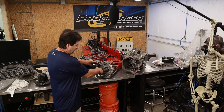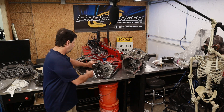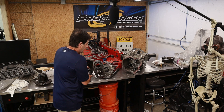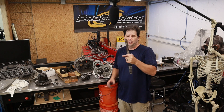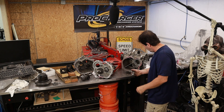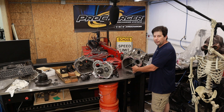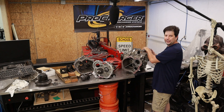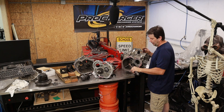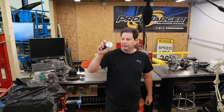These are the new gear ratios — they're a 1.04 gear ratio; the old one was 1.22. I also noticed that this is the drive shaft for the front axle. Obviously I'm only doing two-wheel drive instead of four-wheel drive, so what I've opted to do is make a plug for this hole so I don't actually have to use this drive shaft. It does stick into the bell housing a little bit, so not having it in the way seems like a really good idea.